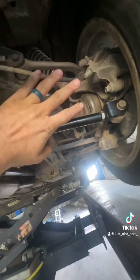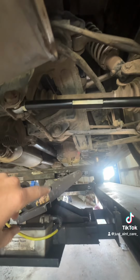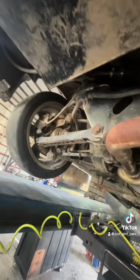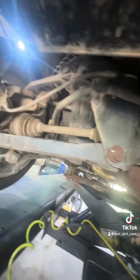The whole rear differential and all the suspension geometry, this is all from a Toyota Supra. I took the entire rear subframe out of a Mark III Supra and just kind of built a frame C-notch on the Prius end and just kind of put it back here as it was. There it is. I'm trying to keep it short. If you want to see something in more detail, let me know.